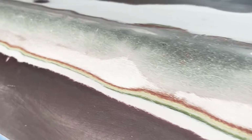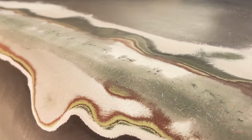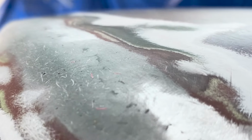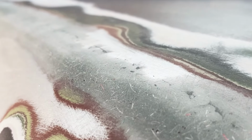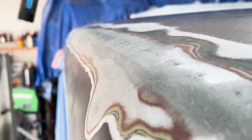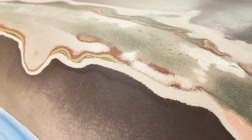It actually looks really nice. Now I'm getting ready for a light coat of body filler, just a real thin skim coat to cover that whole thing and catch all the pinholes. And so that's what we're going to do next. But if you look right here, maybe it won't focus way out there. Yeah, it's hard to see, but the radius looks really good. It looks natural, so I'm excited. All right, let's go into the phase of the little body filler.